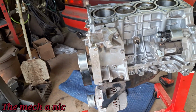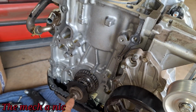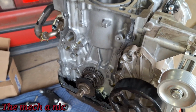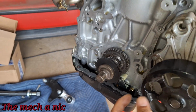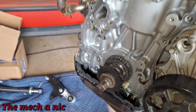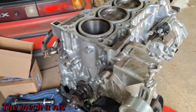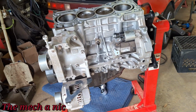For example, think about this. The connecting rod goes up and down, right? Let's just say one of the bolts for the connecting rod cap is loose, hypothetically speaking, okay? Let's just say it's loose, sticking out a little bit. So as that connecting rod is spinning around the crankshaft and it comes in contact with the block, well, you're going to constantly hear that noise every time it comes around. And the more you raise RPM, the faster it's going to get. It's going to have that cadence, right? There's a rhythm. Well, this doesn't have any rhythm. It's just random at what it does.